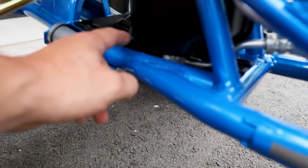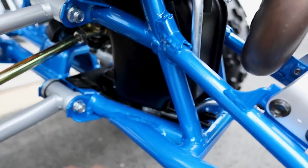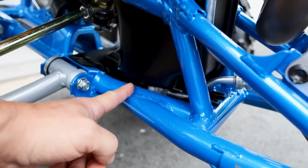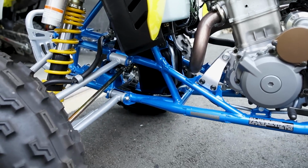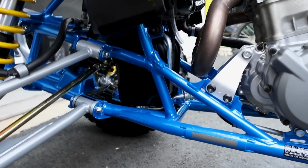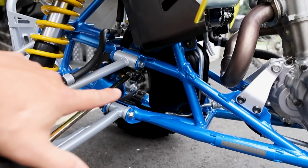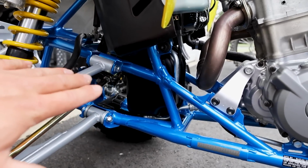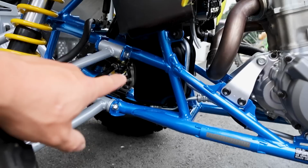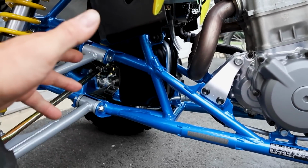So what happened was the drain bolt on the bottom of the oil tank, I noticed when I was putting it in there, it won't take the OEM bolt. It was upsized to an American, I think it was a 5/16 or 3/8, I forget, but probably at one point in time that was stripped out and somebody just drilled it and upsized it. And I just had a feeling it was going to leak. So I'm going to have to pull that back out and make sure that doesn't leak, if I have to change the gasket or something.